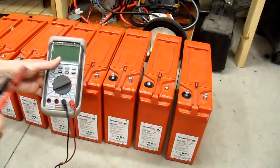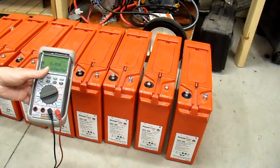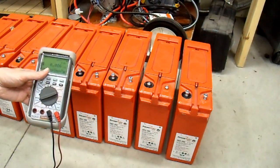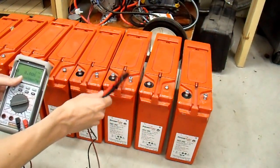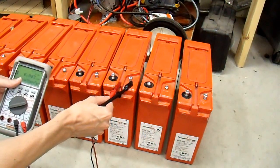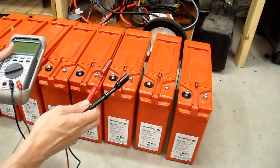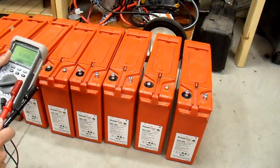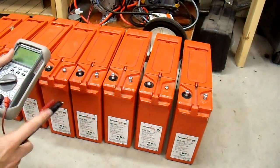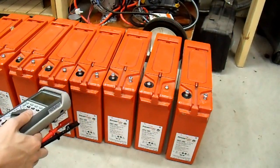Turn it on DC volts and test the voltage of each battery. If it's below 12.5 volts, there's a good chance that your batteries are sulfated and perhaps useless — maybe, maybe not, depending on how long they were in that state. Obviously, if you take a perfectly good battery, discharge it, and then test it, it's going to test below 12.5 volts. That doesn't necessarily mean it's bad, but if it was stored that way for three years, then yeah, it's probably going to be bad.